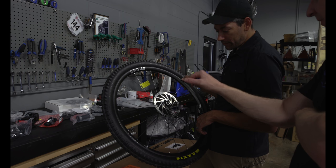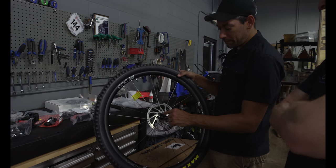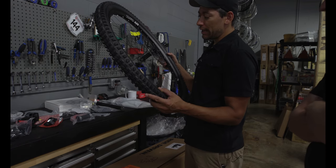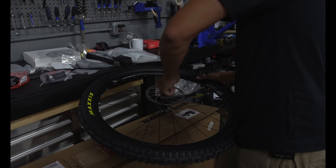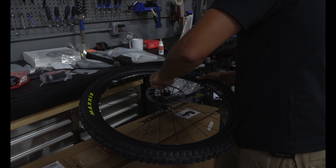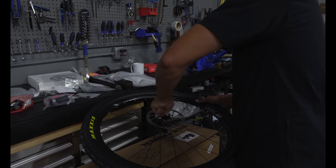And this is the front. This is the front, yep. And they have Loctite already pre-installed on the bolts. Exactly. And these bolts should be torqued to 6.2 newton meters. I've noticed on these type of precision bikes, you're doing mainly hand tools. Yes, not electrics and cheating.